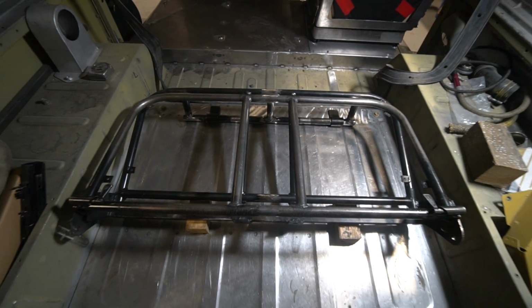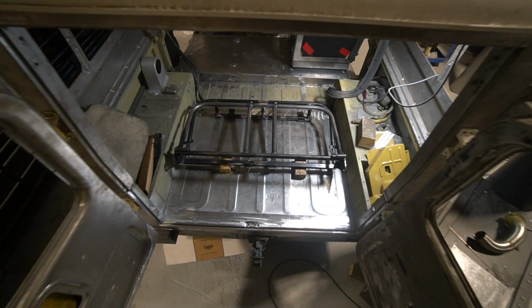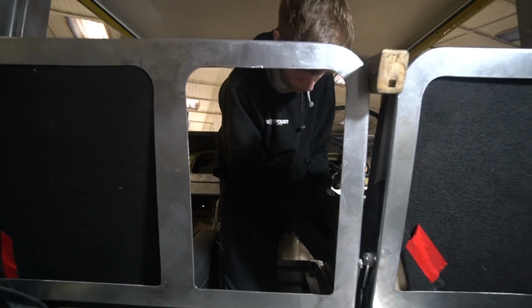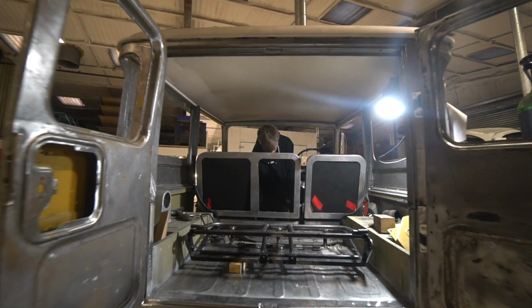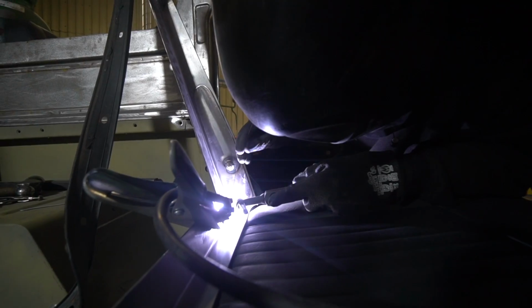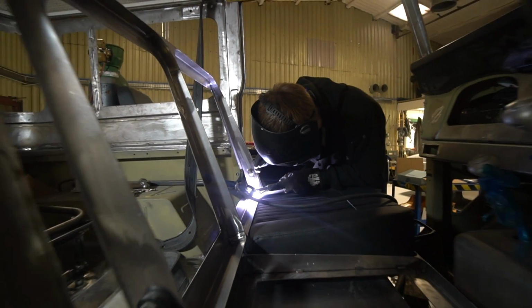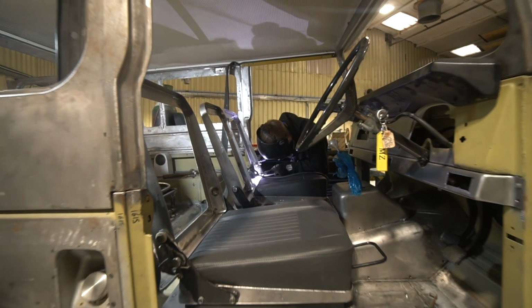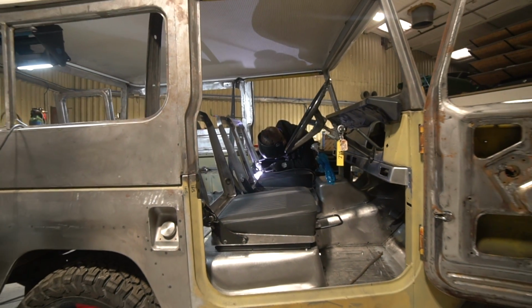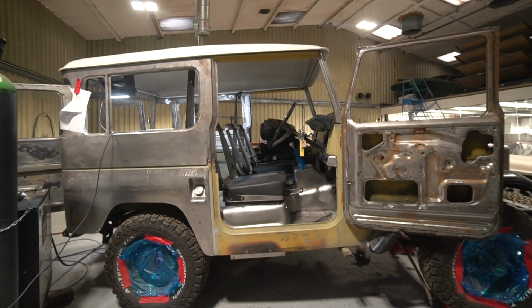Tom's also been working on the final little bits of the front seats. There was some finishing off needed on there with the folding latch mechanisms, the locking pins for those, and various other little bits on the seat fold mechanisms, and getting the cushions in, because we've got to put some little recesses into the wooden backing on the seat cushions to enable them to fit over the captive nuts that hold the seat onto its runners. He's also got the runners all in place and the release mechanisms for the runners all working, so the seats are just fore and aft. That's all done and fitted now.